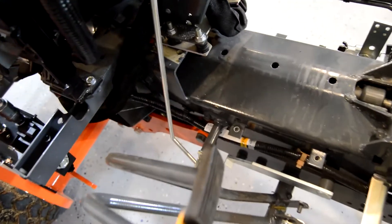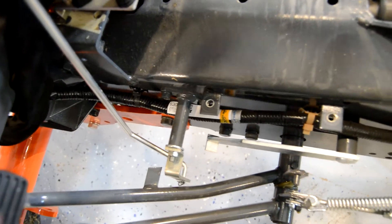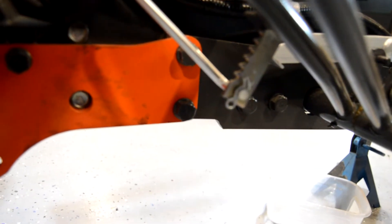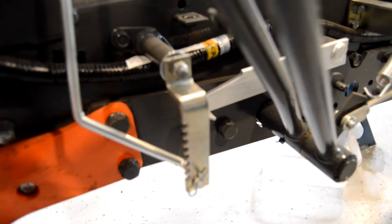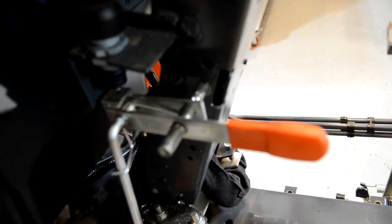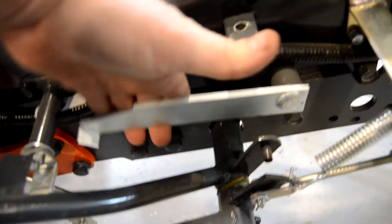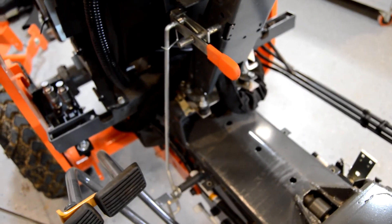I just thought I'd show you how the parking brake mechanism works. These two pedals have a little piece welded on, and when you pull the parking brake lever it engages this ratcheting teeth mechanism so that when you push the pedal again it drops off — pretty simple. For the speed control, I'm assuming it works in a very similar fashion with the same pivot pin. Mine is missing that because it's the SU version, but it somehow engages this jack shaft right here which goes through the tunnel to the other side where the treadle pedal would be mounted. So it should be pretty simple to add speed control if you ever needed it.